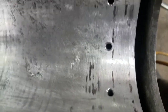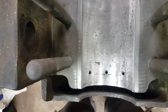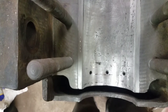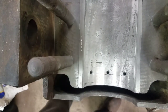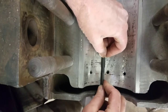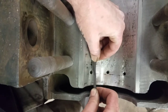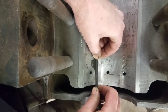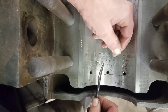I've got the spots where the crank is rubbing, so I'll set you guys up here and I'll try and show you exactly what I'm doing. I think you can get a good view of what we've got going here. So I take my little scraper and I just kind of scratch off those high spots — you can see it peels off a little chip.